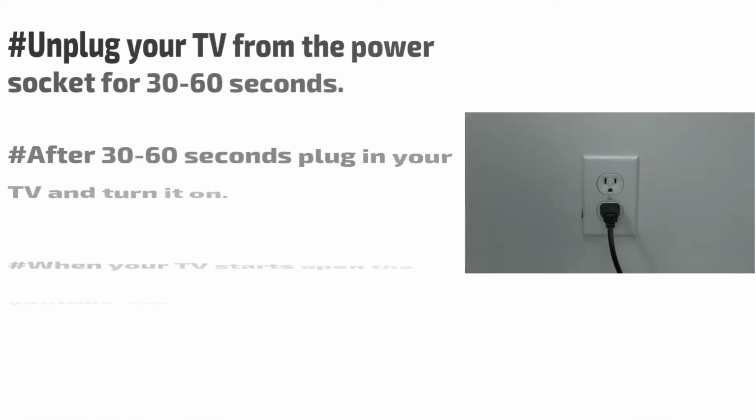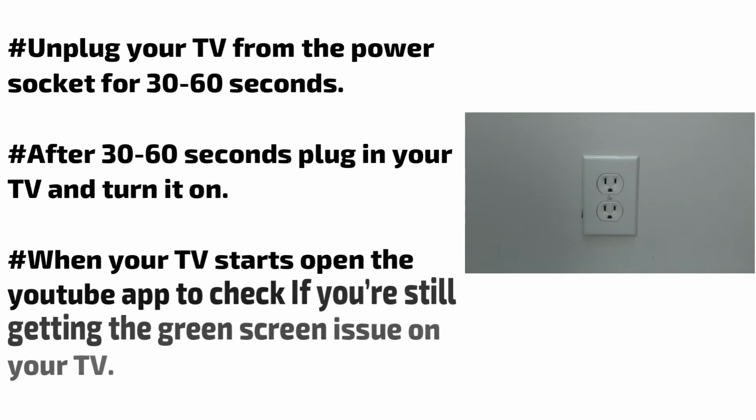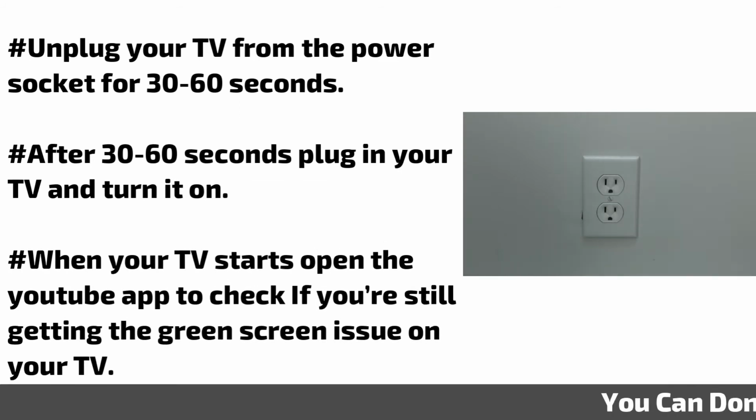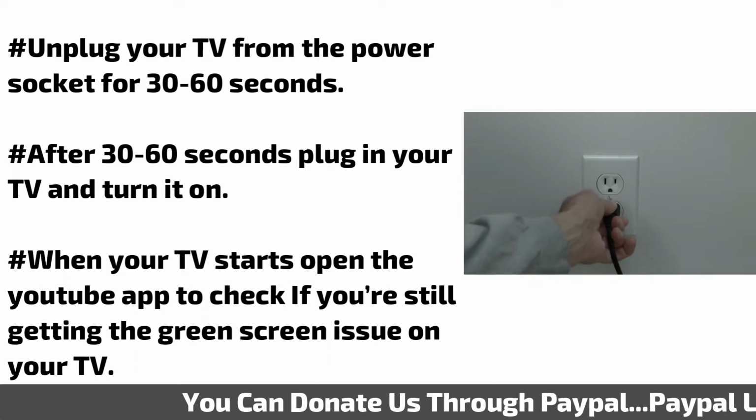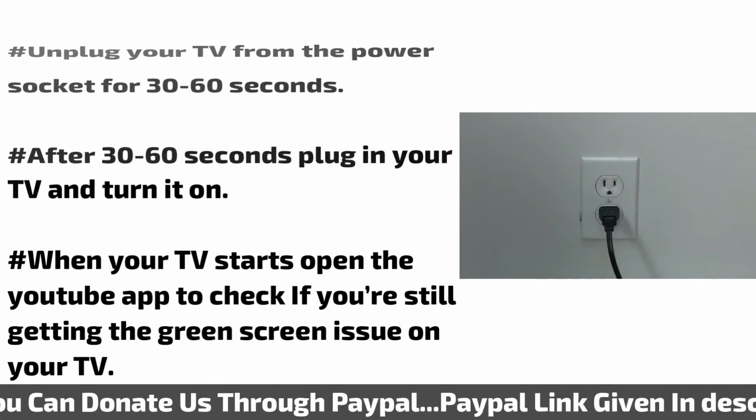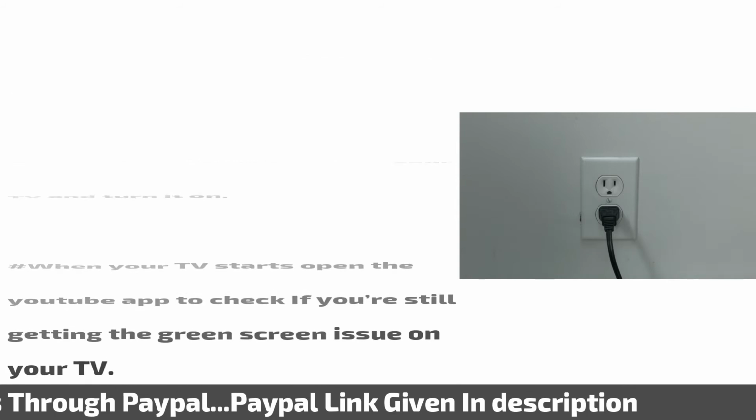Unplug your TV from the power socket for 30 to 60 seconds. After 30 to 60 seconds, plug in your TV and turn it on. When your TV starts, open the YouTube app to check if you're still getting the green screen issue on your TV.